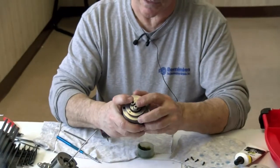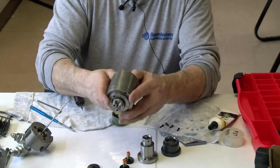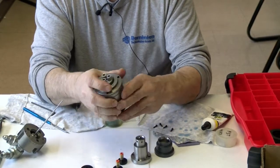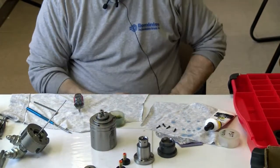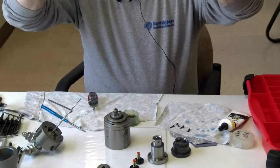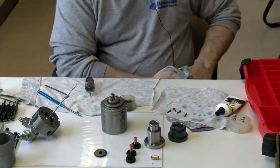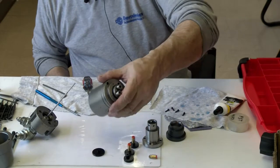Because you need that to be down on those O-rings right there. Because this here is how your fluid's going to come in. Air's going to open that up the slightest and come out the sides of it. And the O-ring is going to stay up in that pocket while the fluid's coming out, because it's forcing it to stay up while your Freon moves through there, and your vacuum. So now I got that part.